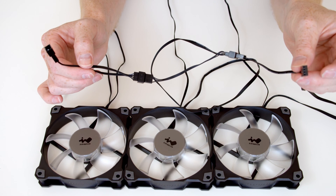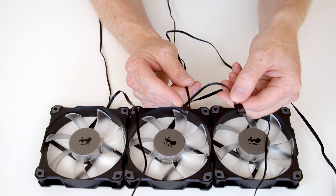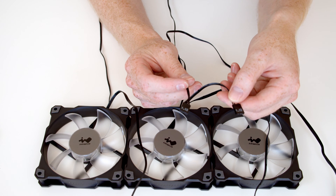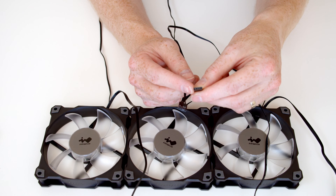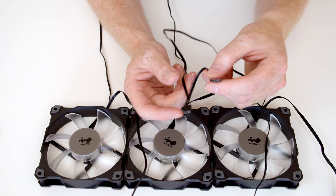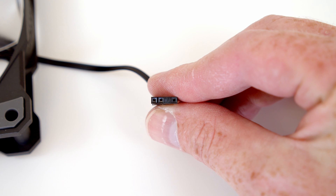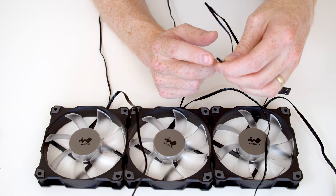Okay so let's have a look at connecting up the RGB. We've got the RGB cable here with the two connectors on the end, so all we would need to do is plug one of these into the addressable RGB header on the motherboard. Be really careful and make sure you plug it into the three pin five volt addressable RGB header, and not the four pin 12 volt connector — because if you do you will damage your hardware. Also make sure you line the pins up the right way. There's two pins, a space, and then another pin, so they're going to have to line up the same way.